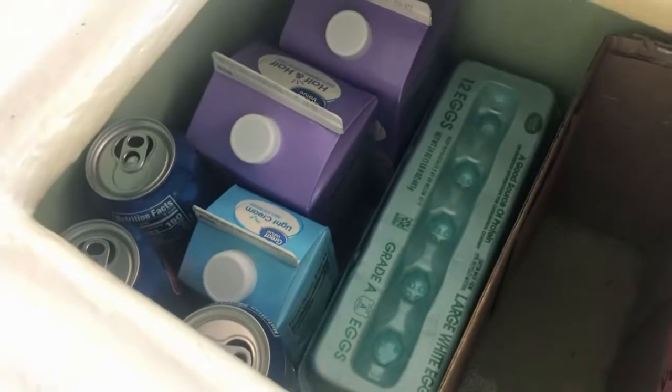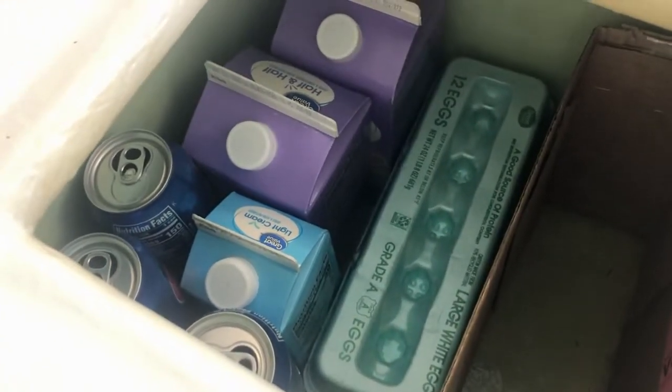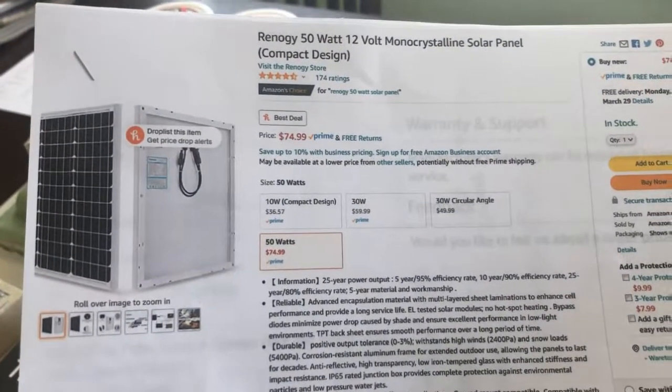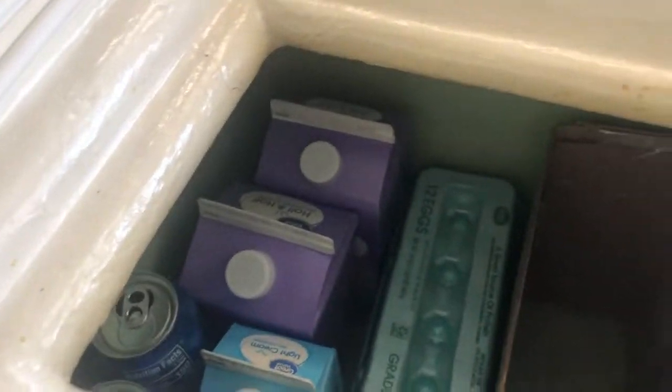I have 70 watts of solar right now and the single battery I have is 120 amp hours. I'm figuring my back compartment is set up so I can get another 50 watt panel on there, and just change out that 20 watt panel to a 50 watt, which would give me 100 watts of solar. I calculated what they show for how much power these refrigeration units would use — they're rated for a five cubic foot space, and I'm at one and a half. So this thing is not going to have to run much, and I've got over about three and a half to almost four inches of insulation in this box.